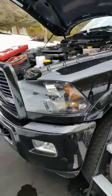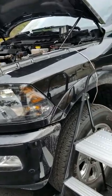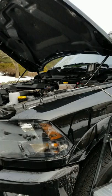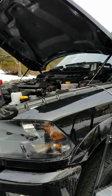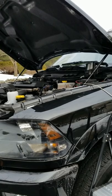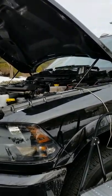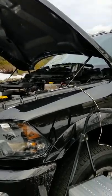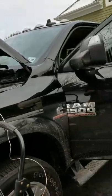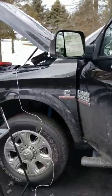I hope you find this video useful and helpful. Please like the video and share it, because I spent a lot of time searching for this. I saw one guy who redundantly wired the wiring harness that came with the LED lights to the upfitter kit, and that was unnecessary. You just have to run the wires directly to it, and then you can use the buttons from inside the cabin. Enjoy and have a good day.